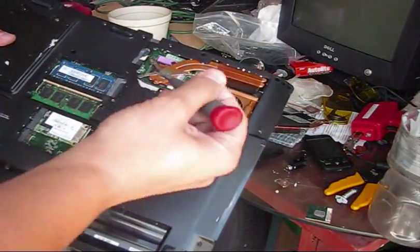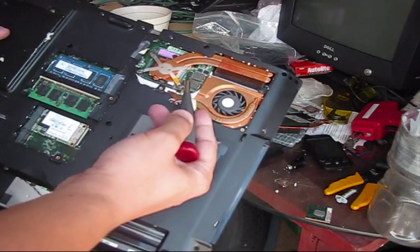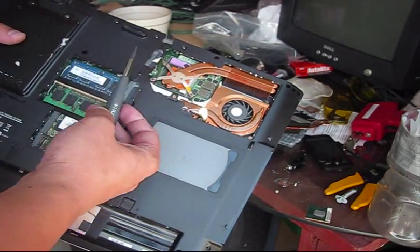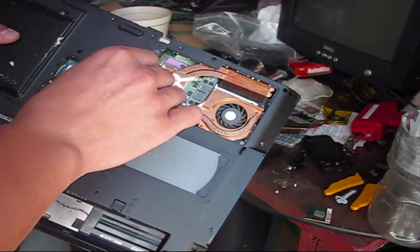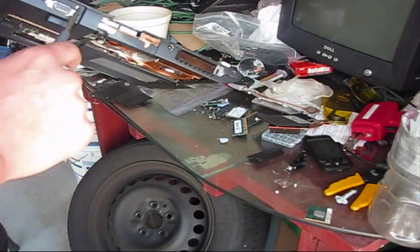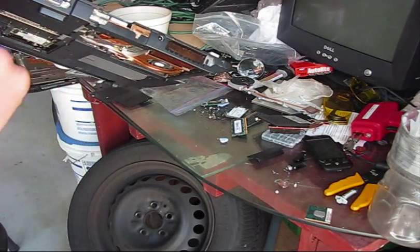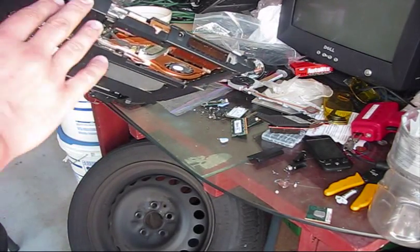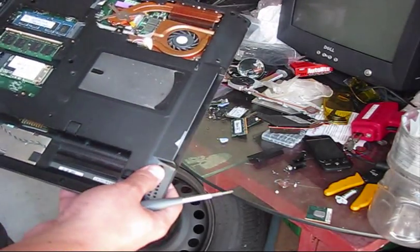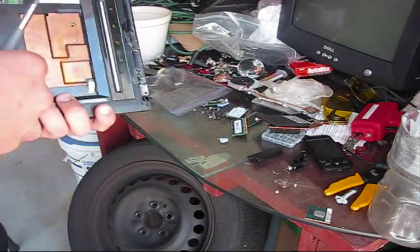When you're done, make sure that you put good tension on the CPU heatsink. As well, when you were installing the GPU heatsink, make sure that you made them really tight. Then I recommend you to put a few screws here and here just to support it, but do not put all of them in case you made a mistake and will need to take everything apart.